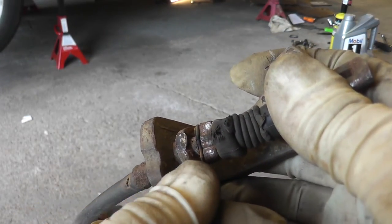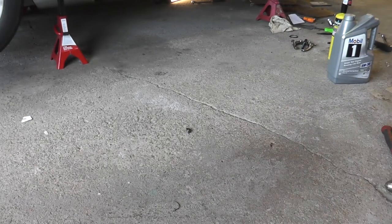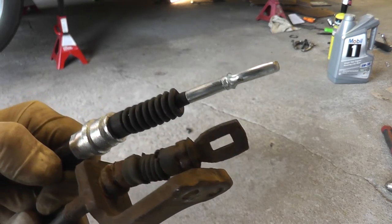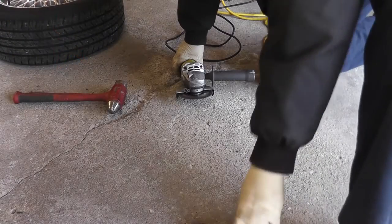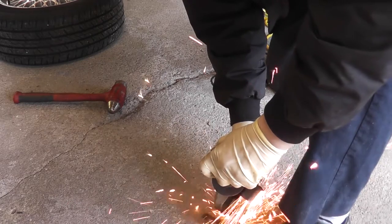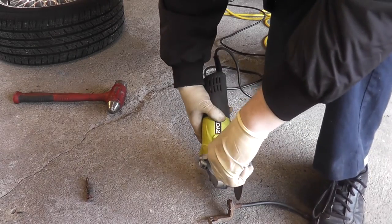As I said at the beginning, the parking brake cable had become seized up in the caliper bracket — it almost looked fused. There was no good way of getting the new cable into the bracket, and the new cable is quite thicker than the old one. I did check the part number and it is the right part. So some modifications were needed: the first thing I did was cut the end off the cable — the one with the eyelet — and then cut the cable away from the bracket, leaving just the bracket to work with.